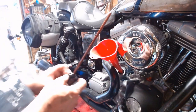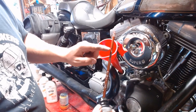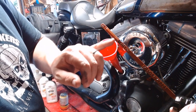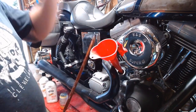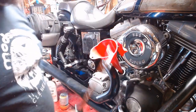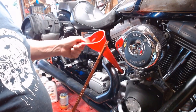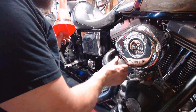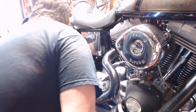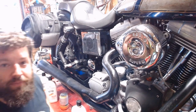Take your dipstick. In case you're wondering, Harleys are set up to be checked with the bike on the kickstand, not standing up straight. There are two marks on here. After you let it run for a second — which pumps up the entire oil system — let it run, make sure the oil light turns off, shut it back off, then check your oil. It should be somewhere around half to three-quarters of the way up the dipstick. Slide your dipstick down in there. If you like what you see, subscribe — link below. Check out my webpage and check out Skidmark Garage in Cleveland, Ohio — take a class or just join Skidmark and be part of the community. Everyone's welcome. That's all I got.